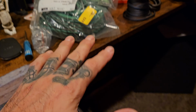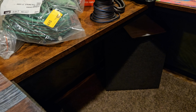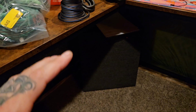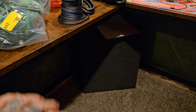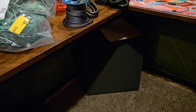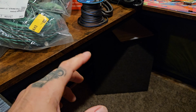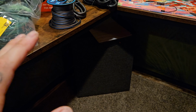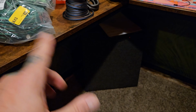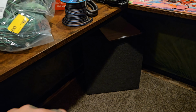But the rears have coaxials, and I can't even really hear them because the factory amplifier is so screwy on how they set it up that it literally gives it no power. These speakers can handle 100 watts of RMS pure power, and that's what I'm going to give them, which will liven them up. But I wired in the crossovers for the front this evening before dinner, got that all squared away, and it sounds decent for it being insanely underpowered, because I'm guessing each channel is getting maybe 30 watts RMS. That's constant power, if that.